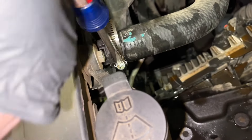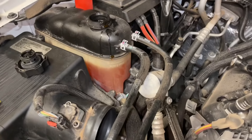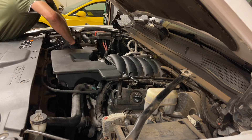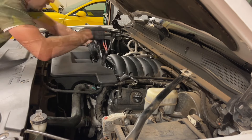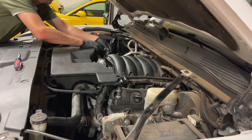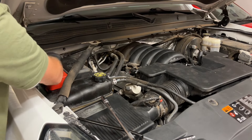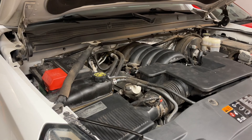We're going to tighten our radiator hose back down and make sure everything looks good on the clamps — make sure we don't have any leaks at this point. The system isn't pressurized yet, but we definitely want to check for leaks. We put the air silencer back in place and connect the air box, using a common screwdriver to tighten down the throttle body clamp and tighten the air intake side as well. Now we click our PCV valves back on. We're ready to connect the battery — we take the negative battery cable, put it on the battery post, and tighten it down with the 10 millimeter.